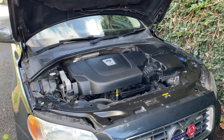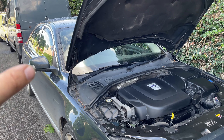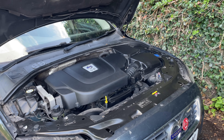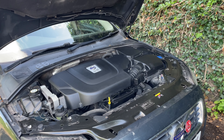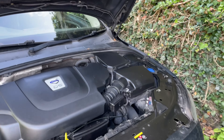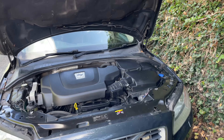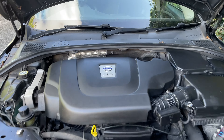One more thing to consider is the fuel filter, located underneath at the rear. That should be changed every 30,000 miles as well, just to keep the fuel system clean and make sure your engine has clean, high quality fuel delivered to it. Cabin filter — I like to change that every 20,000 miles because I'm in such a dusty, high-pollen area. That is all — let me know if I've forgotten anything. Thanks for watching, don't forget to like, comment and subscribe, and we'll see you in the next video.